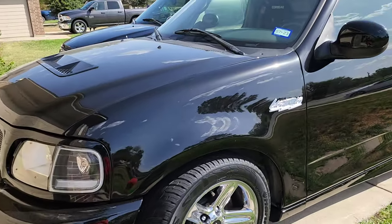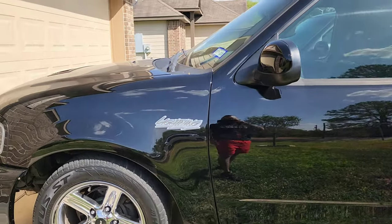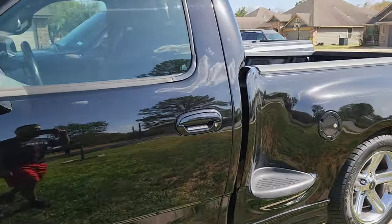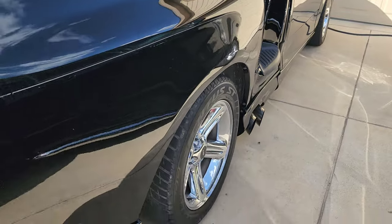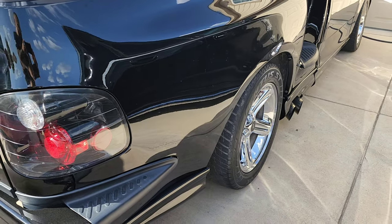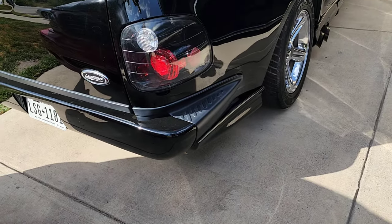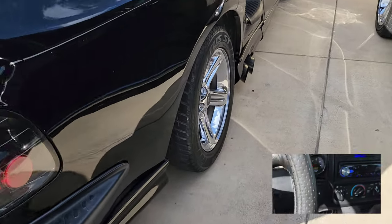The Lightning out here is a little bit dusty. I'll go ahead and turn it on, adjust the throttle absolute, and send JJ at Woodbine an autolog to let him check it out. That's how the truck sounds right now — the throttle absolute is reading around 190. I'm going to adjust it and see how it runs afterwards. Alright, adjusted the throttle absolute, it's all warmed up — see how she's idling now.